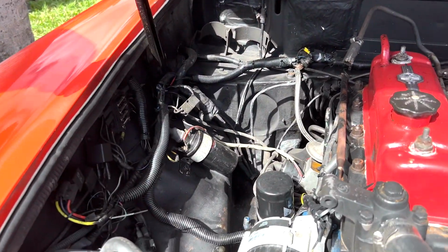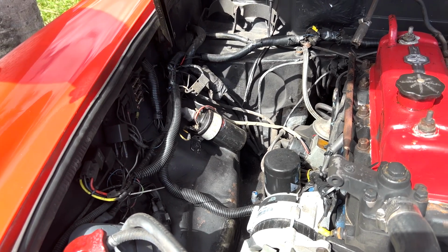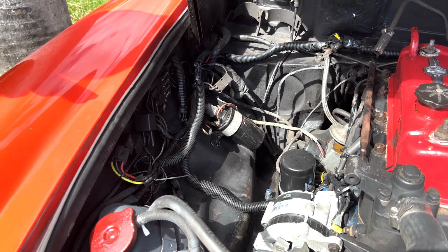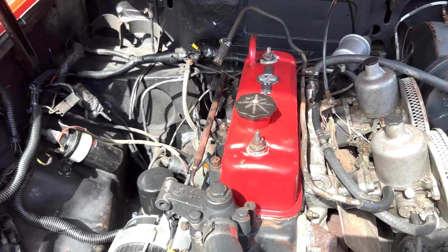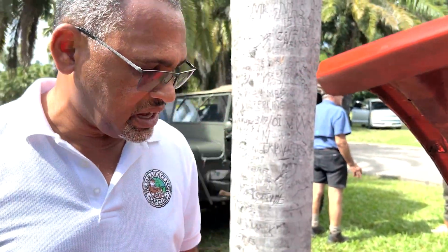So. Okay. How reliable is it? I would say fairly reliable. I've had this car about 20 years now, and it broke down with me twice, and it was because I didn't fully understand the car. The coil in the States, they had a regulator that was attached to the coil but was hidden, and the regulator had gone bad, so the coil kept going bad. After 3 coils I realized something was wrong. I did some research and realized that it was that regulator that they had put on the coil. So I got this newer coil, and since then I haven't had a breakdown.